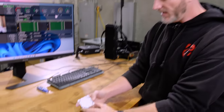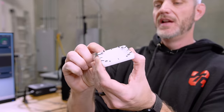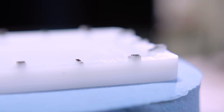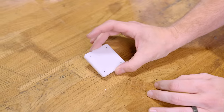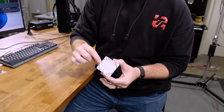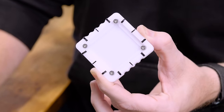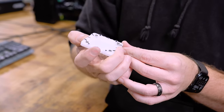Let's take a look at the lapping tool - I almost said deliding tool. The deliding tool isn't ready to be sent yet, but this is the lapping tool. You've got these four corners which screw down to hold the CPU. Der8auer has marked them with a sharpie on top so you can check for flatness - when you're lapping, if you put too much pressure on one side the cooler won't sit properly. These steps look like little Mayan temples; they're for checking flatness. The flat lines in the middle are the lowest point you can go.